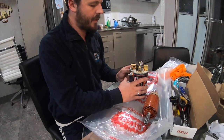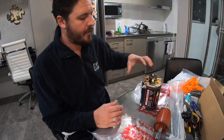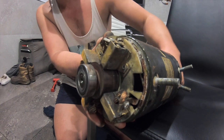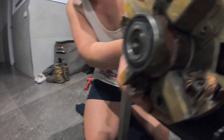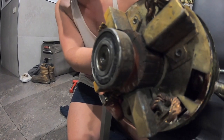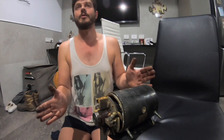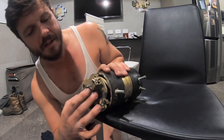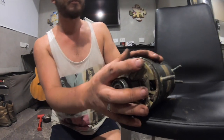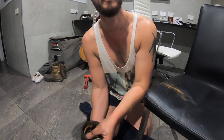So with the motor, there isn't really that much to a motor. We're obviously putting a new motor in. If you're just pulling your old motor off, have a look at it — some things to look for. So this is the old motor, which is very, very seized. Jade's just had to smack the living shit out of it to get it off. But you can see how the brushes work — spring loaded as they are, they just push against that. Because they're made of carbon or graphite, they're a natural lubricant, and they can easily move around there and conduct to power the motor. These brushes are okay. The commutator would just need a little bit of a clean up. There's nothing really wrong with this motor. The housing is corroded. We know that — we would pull the armature out. It could be rebuilt. It's got plenty of life left in it and we will rebuild it.